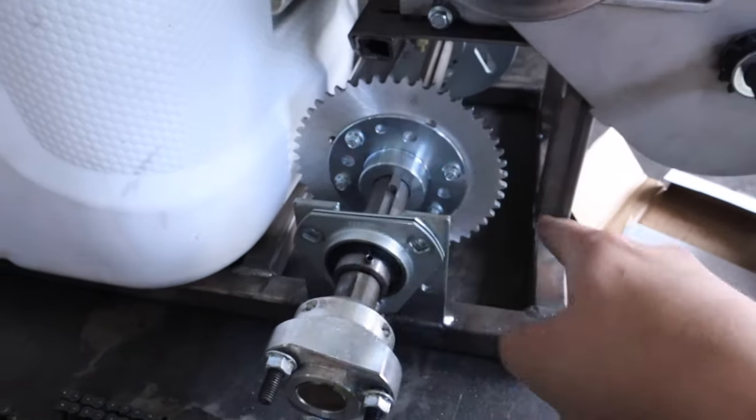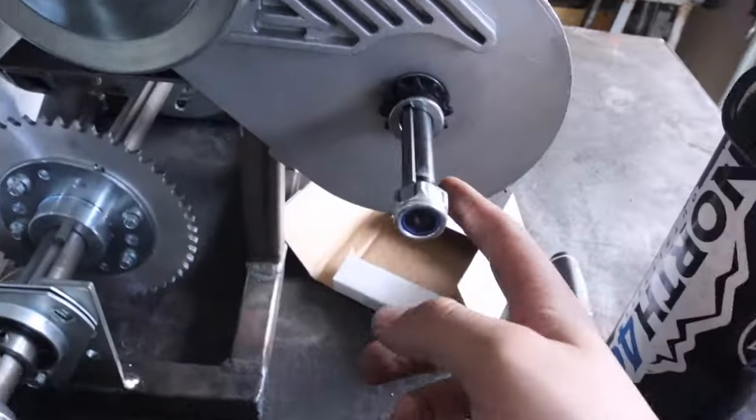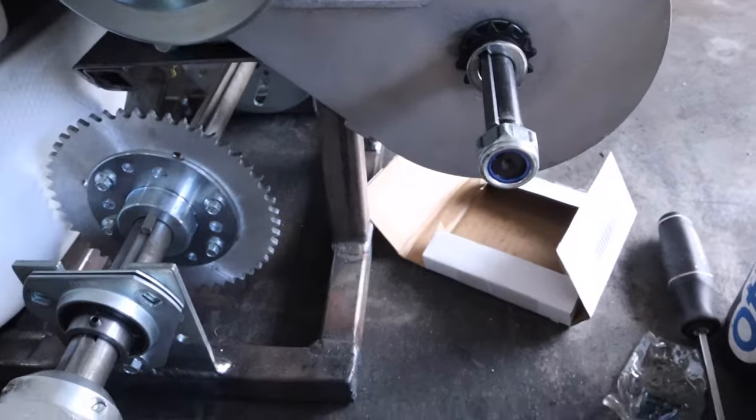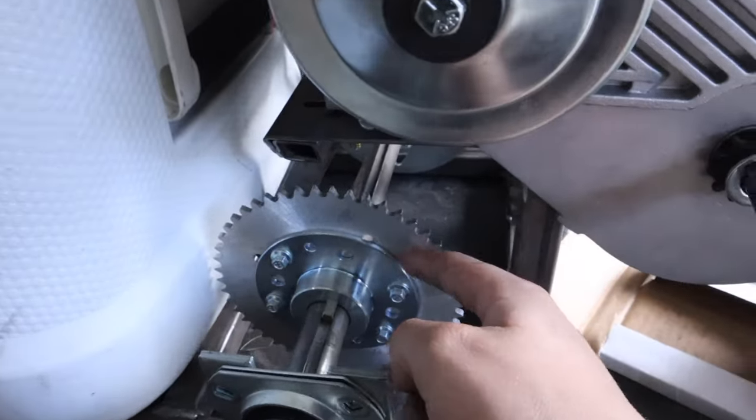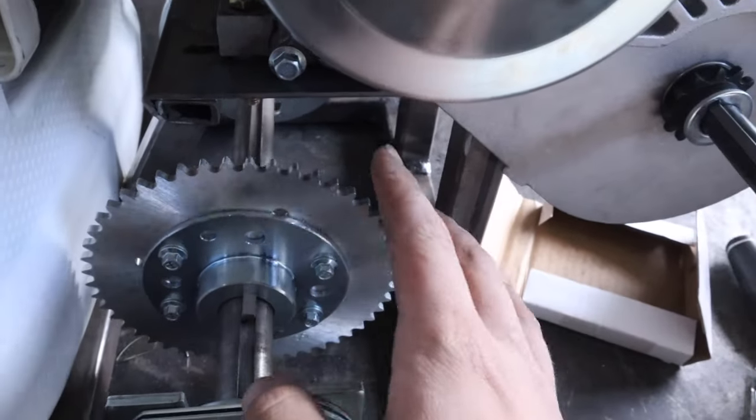So now I'm going to wrap it around. I also took this pulley off, so it's easier for me to get in here - it makes everything a lot easier. Make sure these sprockets are aligned. That's very important, especially for this aluminum, so that this doesn't wear.